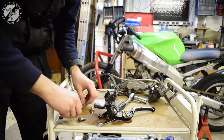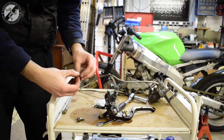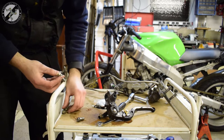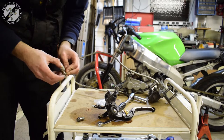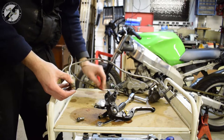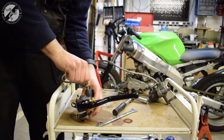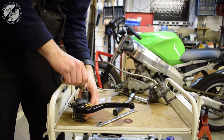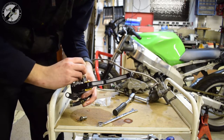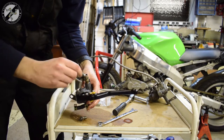Not a single banjo on — go back in. So we have the bolt with one washer on it, through one banjo, another washer on it, another banjo, another washer on it, and then into the cylinder. I'm trying to keep an eye on where the brake fluid is going so I don't strip anything off. I'm going to leave it a little bit loose for the time being so we can get the assembly up and make sure that these lines are in the right place to head off down to where the calipers will mount.